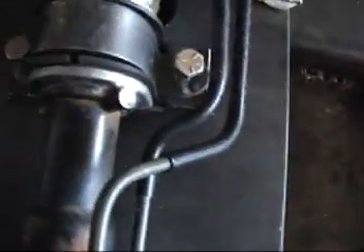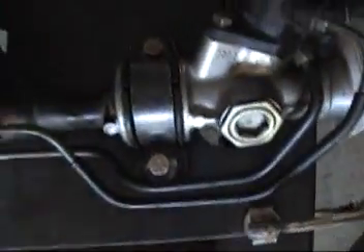I'm now fitting my first steering rack bracket in place and I'm prepping for the second one. I've finished making my three pieces of my bracket. You can see the little U-bracket that goes over the top. There are two plates underneath, kind of ground down to make them fit.